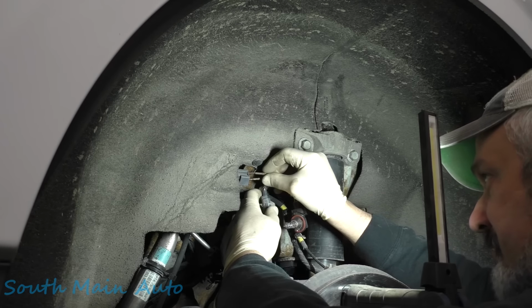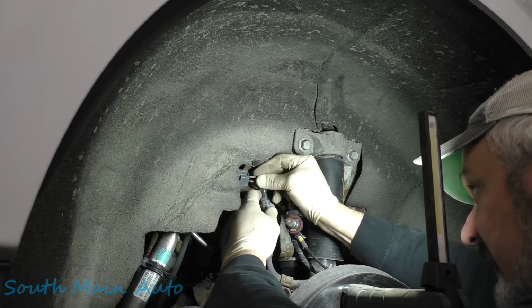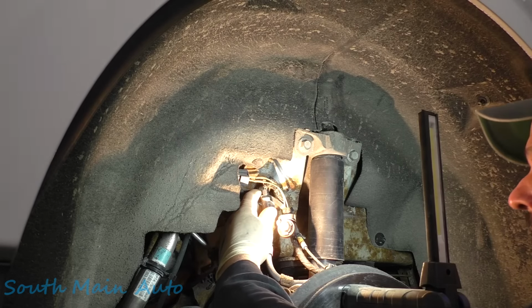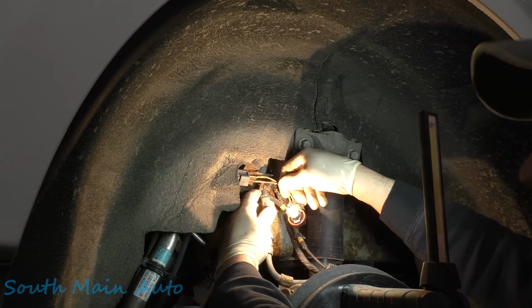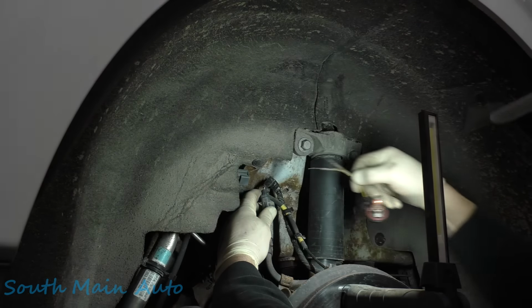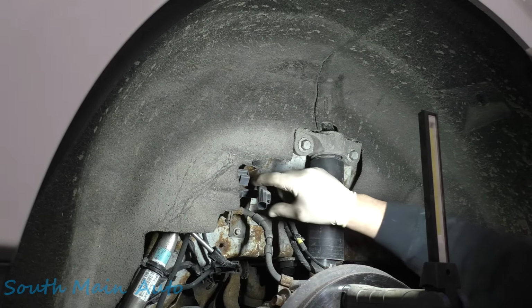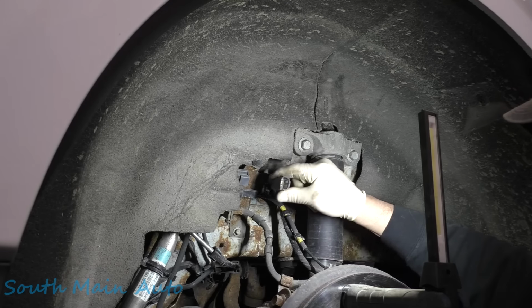The connectors are pretty resilient, really. Okay, that probed in nicely. I'm going to hit yes. Okay, there we go. Still waiting for this motor, so it's keeping the light on. We're going to unplug it. Okay, so that's it. We know that there is an open in this harness for sure.